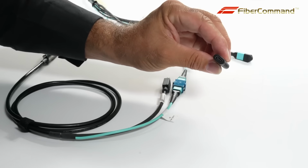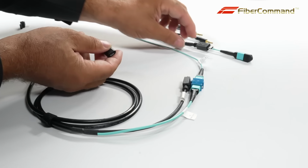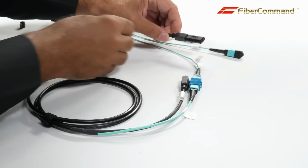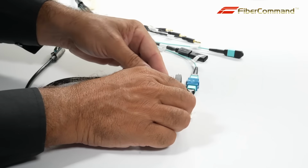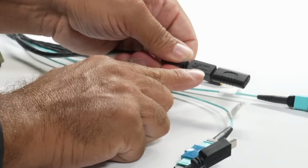Now use the included coupler to connect our patented long-range eARC audio return link to the matching cable connector. Connect the same on the HDMI termination to the coupler. Check for the arrow side as it must be on the same side of the arrow on the cable.